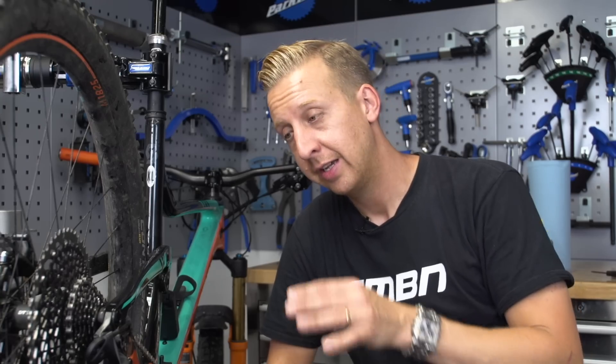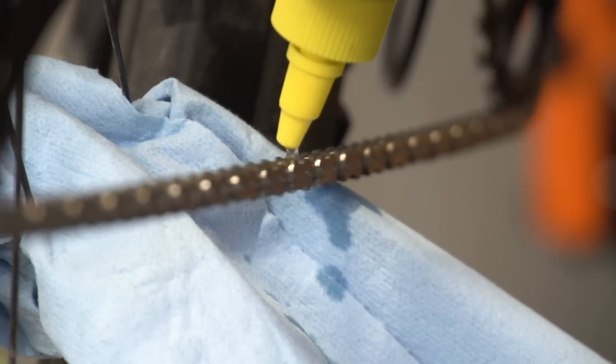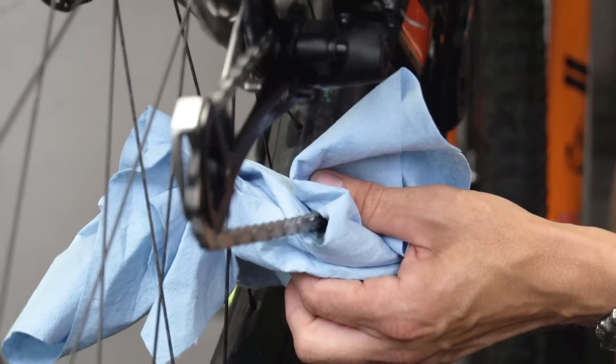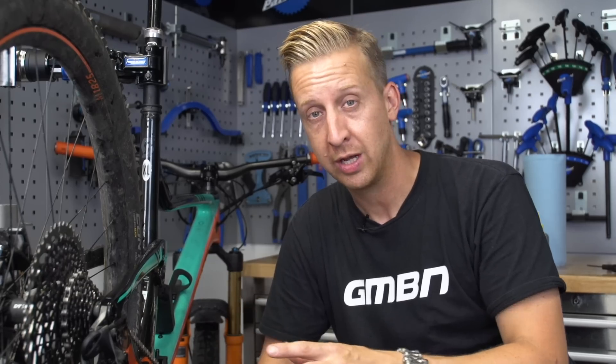Finally, a couple of other things you should know about chains and lubricating them. People often ask how much lube they should use, and my advice is just enough to coat the chain. You don't want to use too much because it's going to be a waste, you're going to end up wiping some of it off anyway, and it's obviously going to attract too much debris — mud, muck, all the stuff that wears it. So in my opinion you definitely want to do little and often: just pay attention to what's going on in your transmission, apply what you need, and you'll get more out of your lube and your drivetrain.